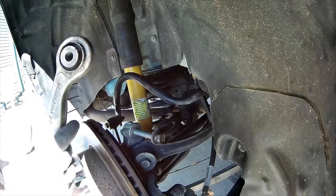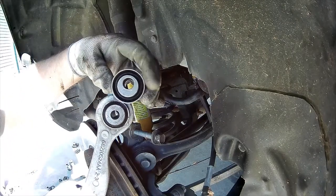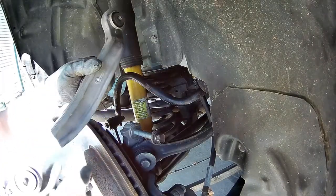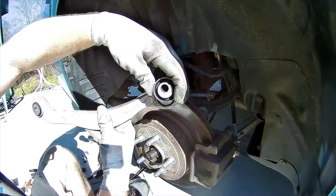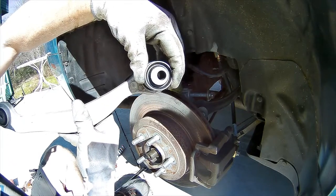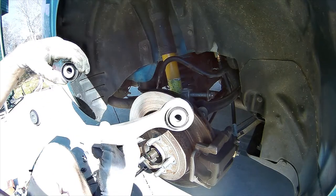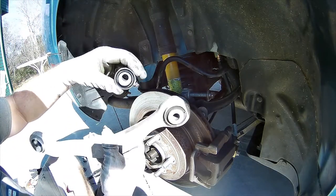So what you do is knock this bushing out and replace it with this one. This is how it goes in the car. Basically you can lengthen the rod by putting this bushing in like this - it makes the hole more forward and gives you more camber. More positive camber, I believe - it pushes the top of the tire out. Let me get my stuff ready to try and press this in and I'll start it back up.